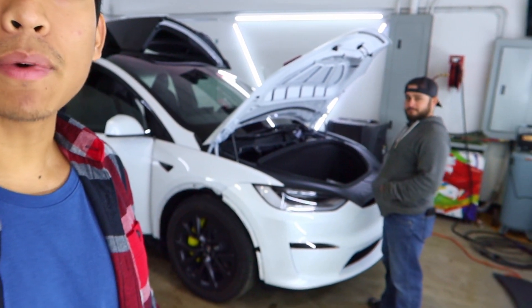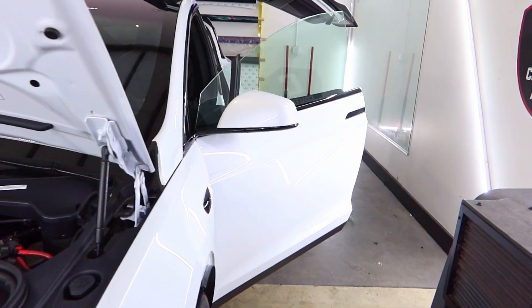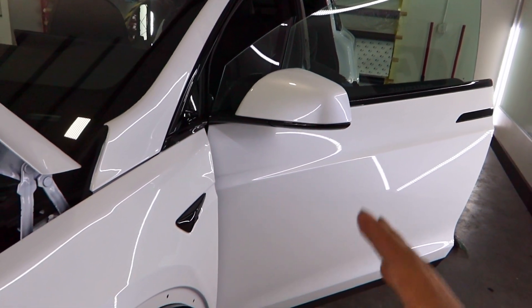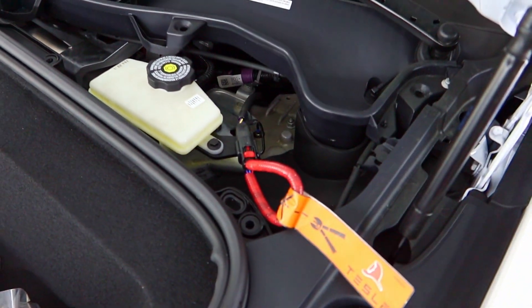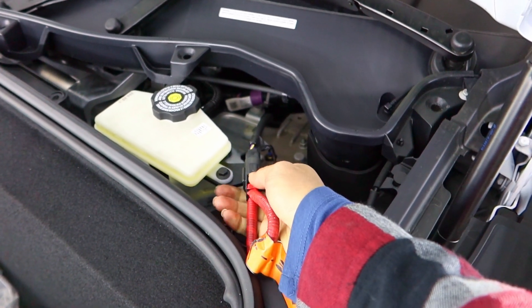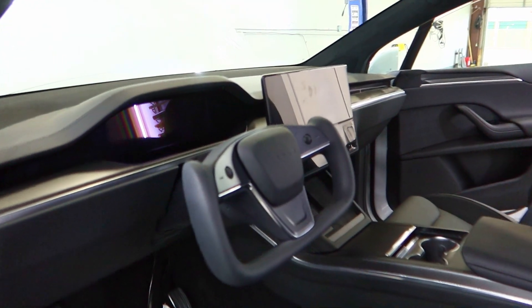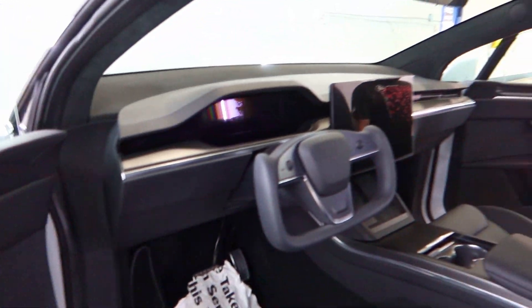We are about to remove the battery. The Tesla is now getting ready to have accessories taken off — like the doors, sensors, and a few other things — so we can do that without having to recalibrate things. We're going to go ahead and disconnect the battery. This is the main wire right here — you see this wire with the fireman hat on it? You disconnect this and the whole car turns off. It's a safety switch. If I unplug it you're going to see the whole car shut off. Just like that, the whole system is off. When we plug everything back with the doors open and power back on, the car should not think it needs to be calibrated. That's how you trick the ECU on a Tesla.